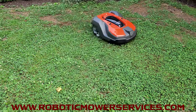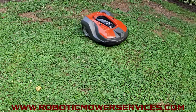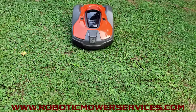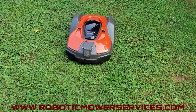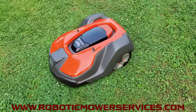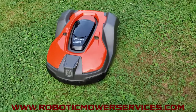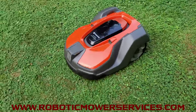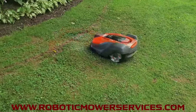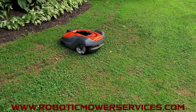Now this is something that usually isn't an error that just happens on its own. It's something where somebody pulls the mower out of the charging station — or it rolls out for some reason — before it's supposed to leave, and that's what causes this error. The charging station still thinks the mower should be in there and it's not going to turn the power on to the boundary wires until it thinks it's ready to go.